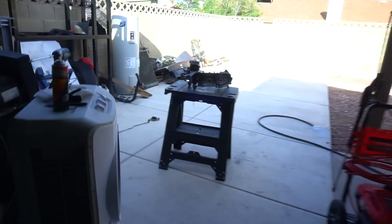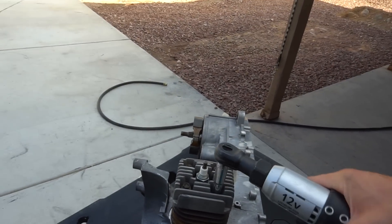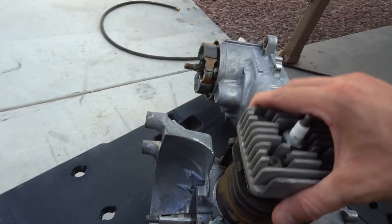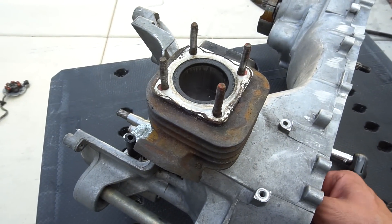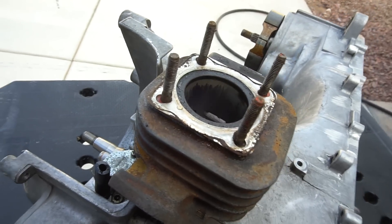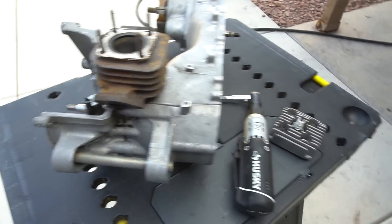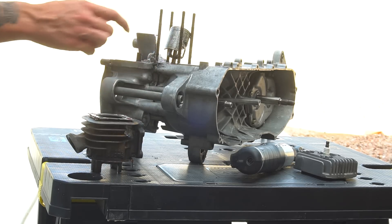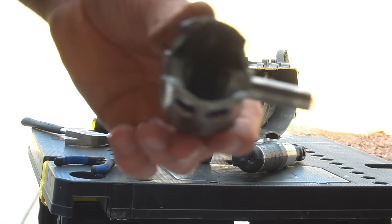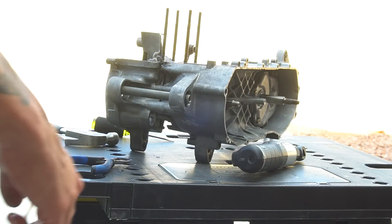Let's see how we're looking in the cylinder part of this engine. Everything else is looking pretty rough, not gonna lie. I noticed the flywheel was just caked in dirt, so it was probably not getting a good connection from the flywheel at all either. This thing does not feel good at all on the top end. She's definitely been seized a lot — there are metal shavings all caked up in the deep side of this piston. It's packed in there. This one's rough.